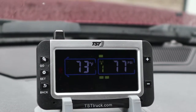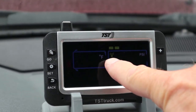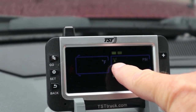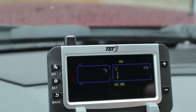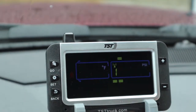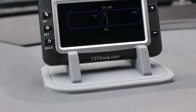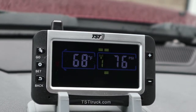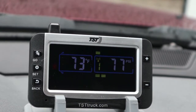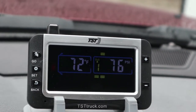It's only been about four minutes now. Once you get the icon for the repeater — looks like a little tower with a signal on both sides of it — then the tire data will start coming in one right after another. Usually there's a right rear, left rear — no data, right front — no data, left front — no data. Then left front has data, right rear has data, and we finally got data on the left rear and the right front.